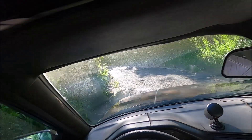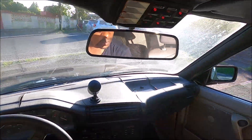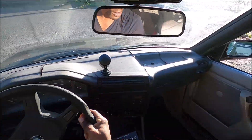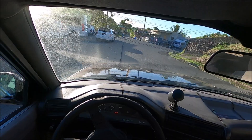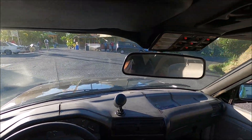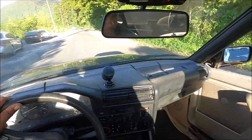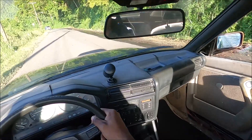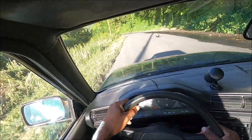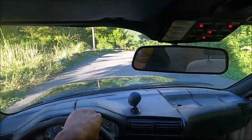I'm just going to continue tweaking and we'll see where we end up. I made some changes and I'm back out for another drive. Let's see how close my fuel table changes are. You can hear my fuel pump — must be low on fuel — but I'm monitoring fuel pressure. I'll look at the logs when I get back. I can see here I'm reading right around 14.6, and my target is 14.8 cruising, so that's good.